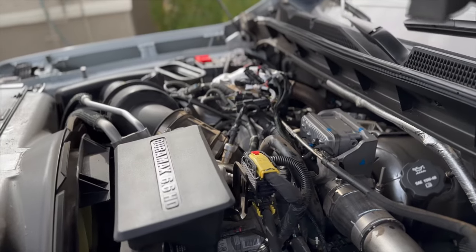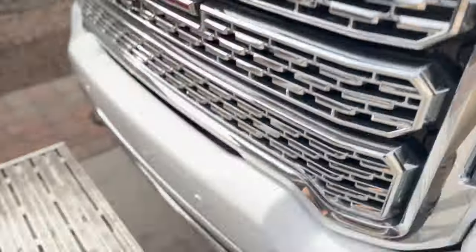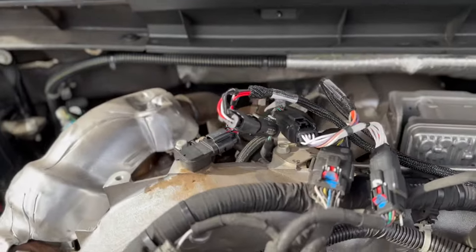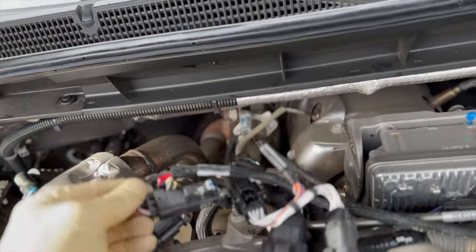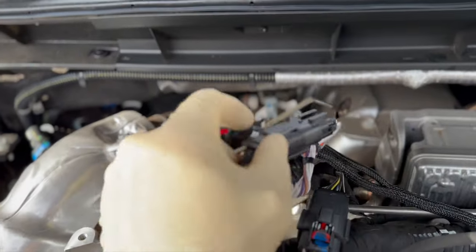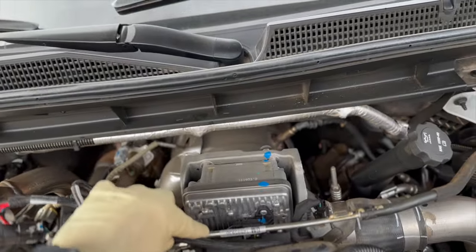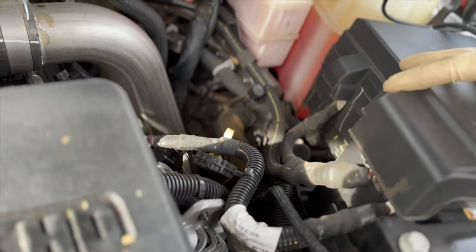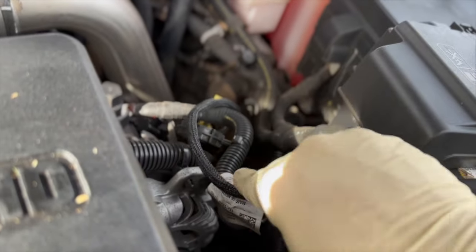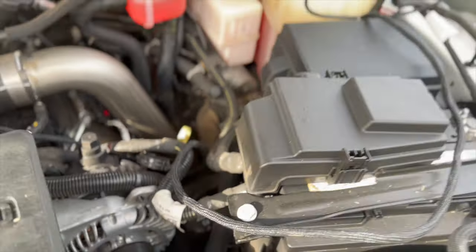Here's what I've got so far. I'm routing it along where the harness already is — haven't zip tied anything yet. You can see that these are plugged in-line: here is the MAP sensor in-line with the connector itself, and here is the fuel pressure sensor also in-line. You disconnect them and plug each male and female back into the Banks harness. I ran it near the actual engine harness and just followed it along down. You want to stick with where the factory harness already is so it's not going to chafe or rub on anything.